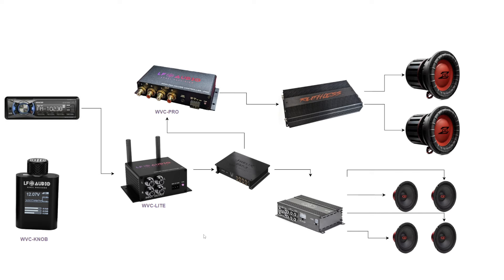This allows us to have that relative volume for the subwoofer compared to master. Just like in the previous example, we click the top of the knob to switch from master channel volume group one — which controls master volume across all devices — into the secondary channel group, which attenuates the signal for the subwoofer amplifier. This is a bit more complex, but gives us full control with active DSP for fine tuning.